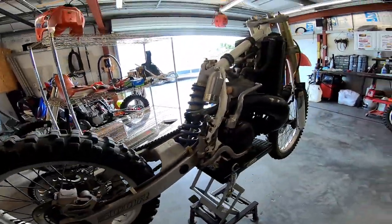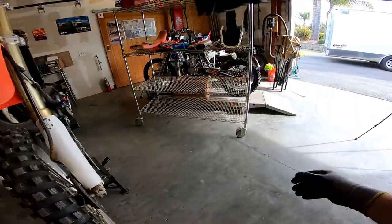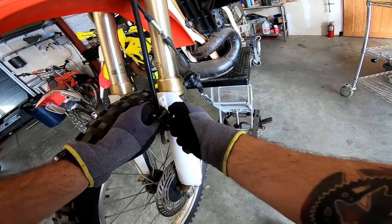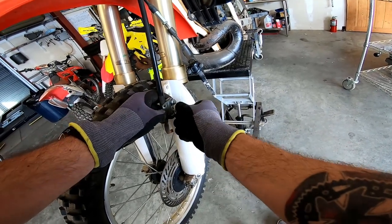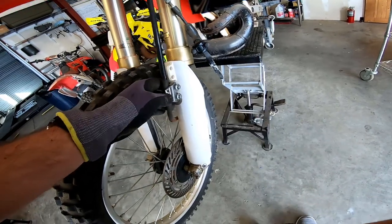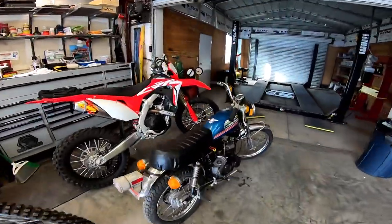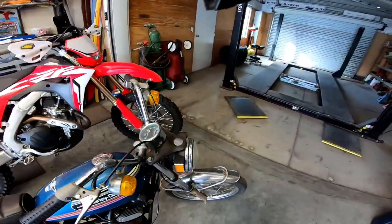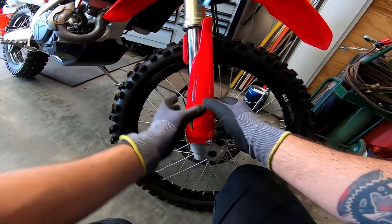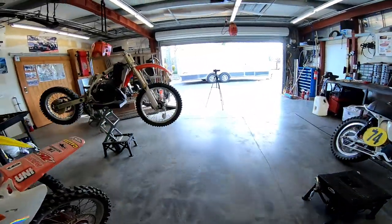I'm going to start with the front wheel and then strip the forks off. Actually we'll start with the brake because it's just hanging free right now. This stuff has not changed much. Even these fork guards — you can run 2020 fork guards on these old forks if you want, and we probably will. They have really cool little slits in the sides of them since maybe 2018 or 2019. I'll show you guys those real quick. 2019 CRF450X — you can see the holes, and the bolt pattern is exactly the same. You can also put KTM-style guards on these. A couple years back KTMs used to be a full wraparound style instead of a gap in the back, and those actually fit the Honda as well, if you're looking for an off-road option and want to protect your forks a little more.